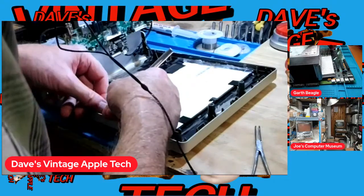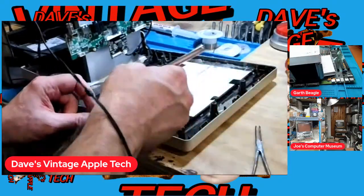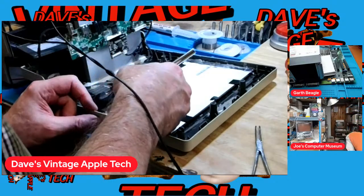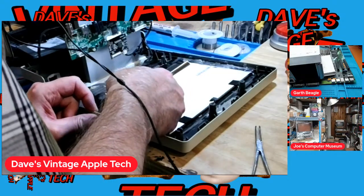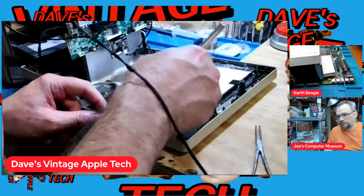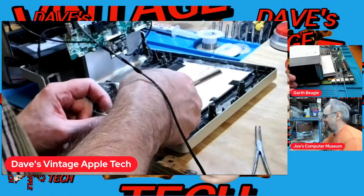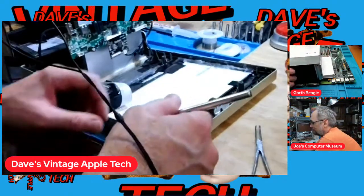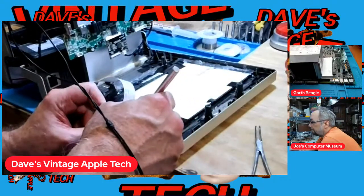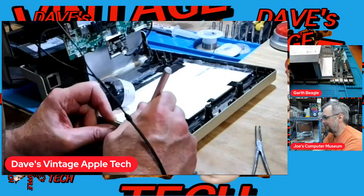Okay. I don't know if this thing boots. I'm just going to see if I can get a chime out of it. I don't have a video card in. Will it chime without a video card? This is the 2CX, so no built-in video. Basically they took a Macintosh IIx and crammed it into the compact case, the first one. This is all above board, using a Jazz drive to hold the power supply, and speakers attached. All right, power's on. Let's see what happens. 3, 2, 1.